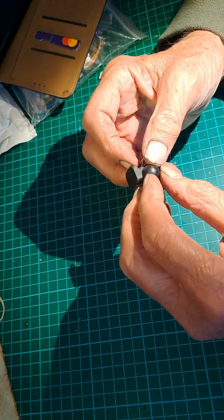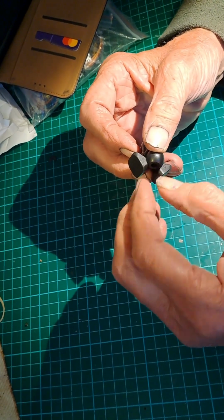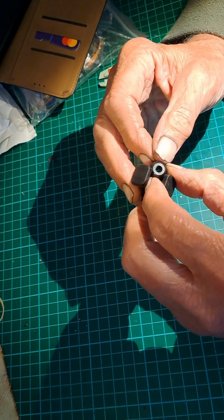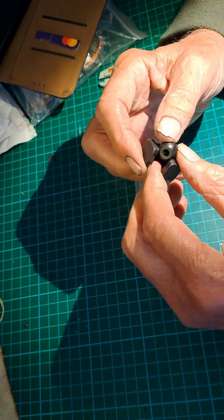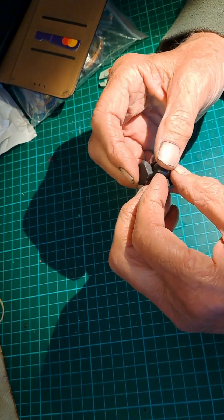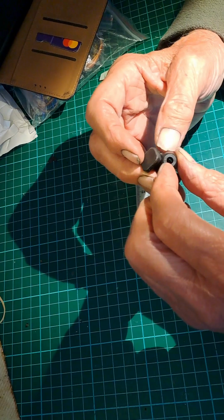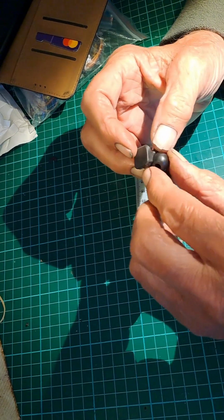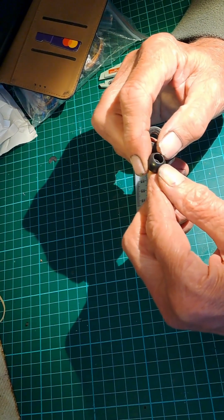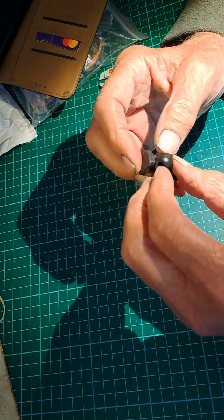The size of the braze-on boss that this fits onto is such that if I tried to countersink this similarly, it's not much different to taking the whole of that already flat area down a bit anyway, because it's a wideish diameter. So that's the thought.